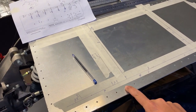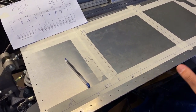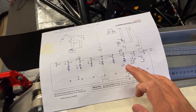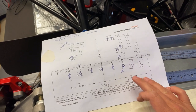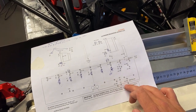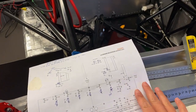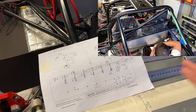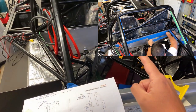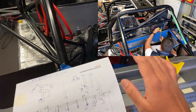Slowly but surely marking out the rear bulkhead panel here. It's been a bit of a pain — the drilling of this by the factory in the body pre-fit wasn't exact, so I'm going to have to slightly over-drill these holes and run a washer on them, which isn't the end of the world. I've got all the points marked out from the factory-provided diagram, but you need to look through this for your specific application. I don't have heater hoses so I don't require those fitments. I've got a mounting for the high pressure fuel pump, but because I'm running the electric water pump down in that position, I can't really fit any of this off until I mark it all up in position.